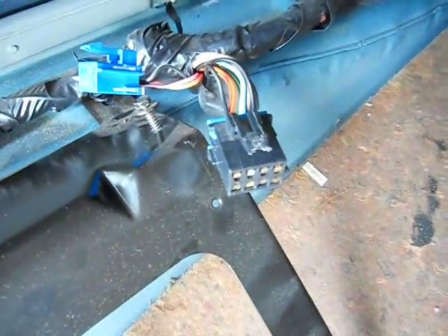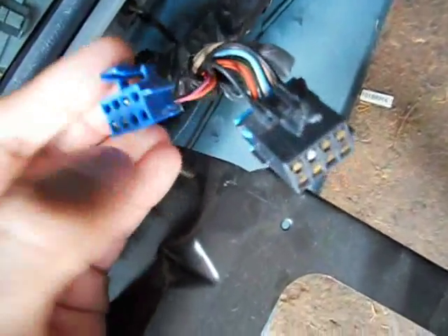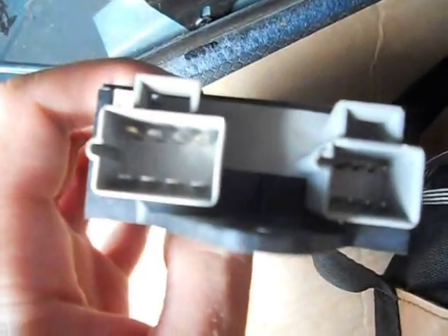This keyless box is a piece of shit. I do actually have an Apollo box. I couldn't make it work, but I've got to rewire the pins — take the pins out of the connectors and swap them around. Because different boxes have different amounts of pins. I've got six on that side, some only have like four, and that side is loaded up.